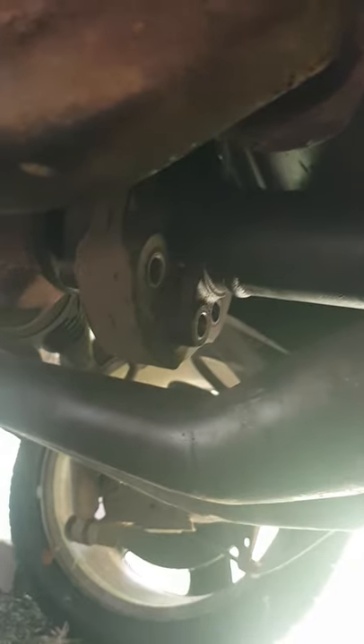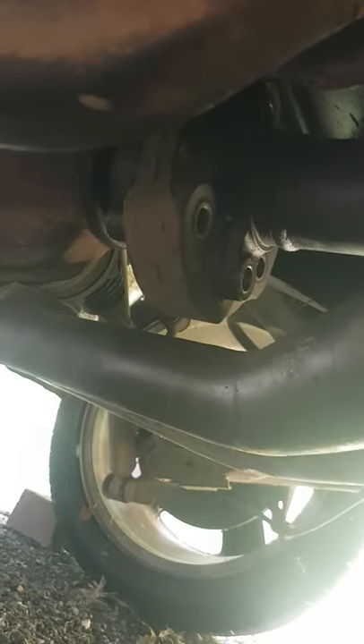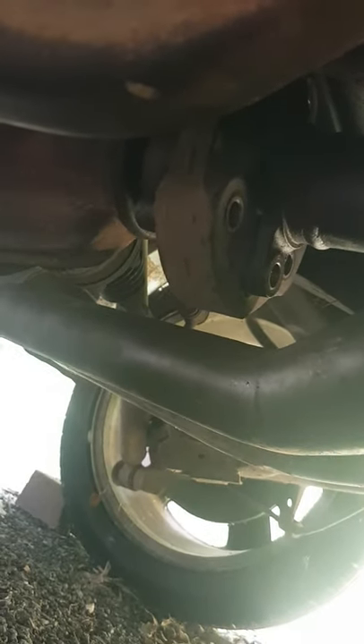Then we go under here. Tail shaft — as you can see, I've already removed the tail shaft bolts. The next step in the process will be to remove the center bearing bolts, which are way up under there, hidden up under the exhaust. Once I undo that I can drop the tail shaft — it should be able to slip out that side, other side of the back of the exhaust there.